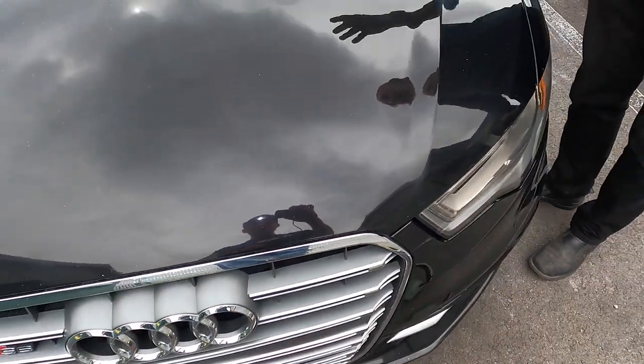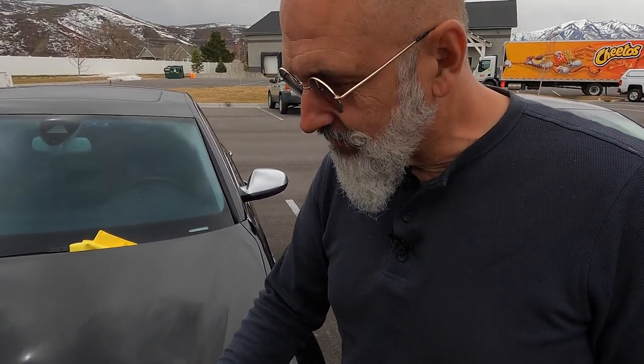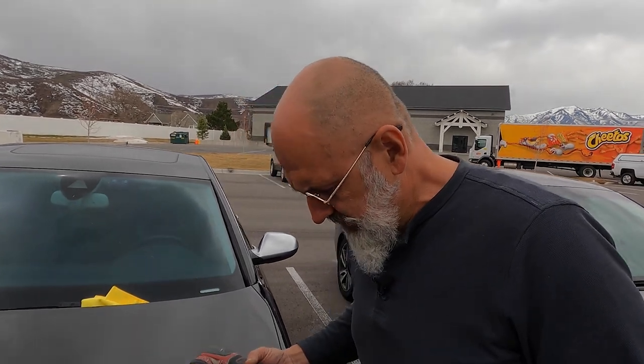This is one of Nick's neighbors at his shop — he wasn't expecting anything from this, so for him this will be a spectacular improvement. What should people promise or not promise if a customer says 'can you polish my PPF?' Just say 'I'll try, no guarantees — if it works, great; if it doesn't, change the piece of PPF.' PPF is comprised of multiple layers, so you don't want to break off that top layer or you've screwed up the PPF. Don't put heat to it, don't over-abrade it. Use a finishing polish with light pressure, low speed. Don't create heat, don't create pressure, don't create more defects than you're trying to remove. You can permanently haze it, or remove the self-healing layer — there's a lot of bad stuff you can do to PPF when polishing.